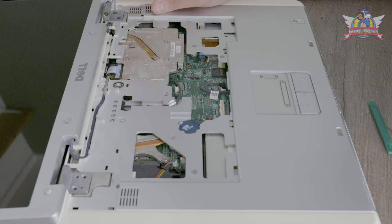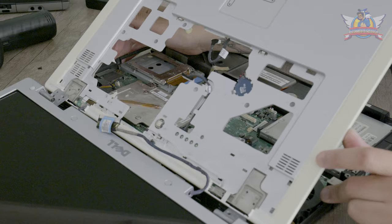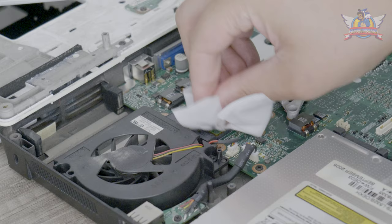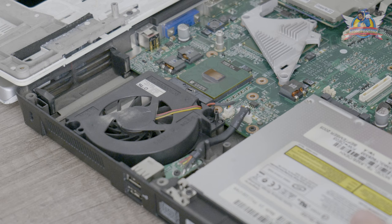Removing the screen opened up the way for removing the bottom plate, which did take me some time. I take the blower and remove the first signs of dust — there's a lot here. The CPU paste isn't present and the vapor chamber is full of dust. I remove whatever is left of the old paste, then blow out the vapor chamber.